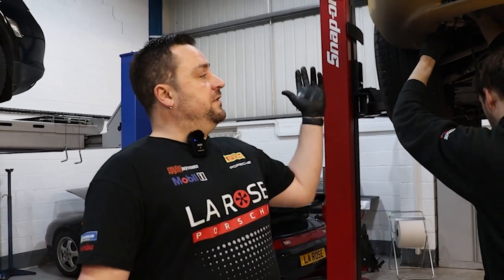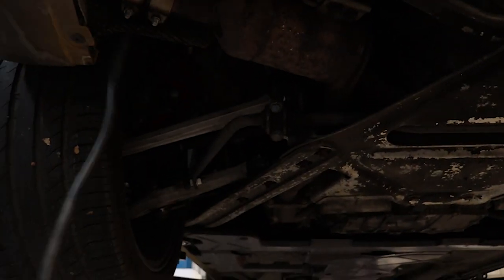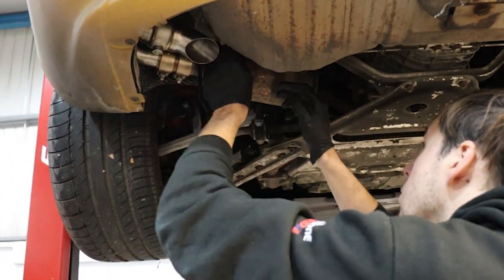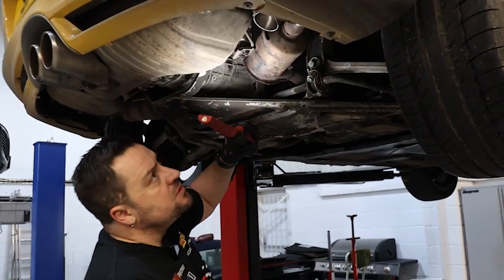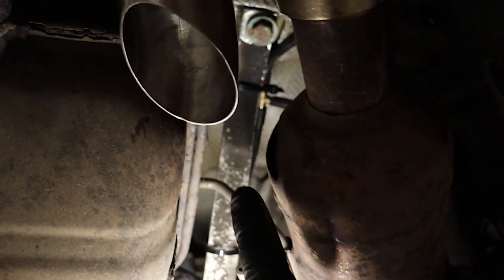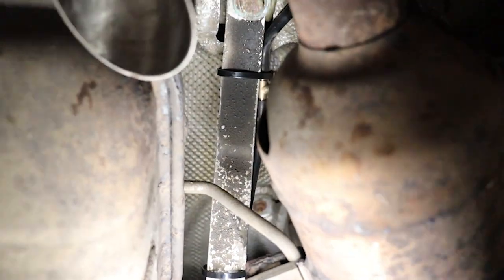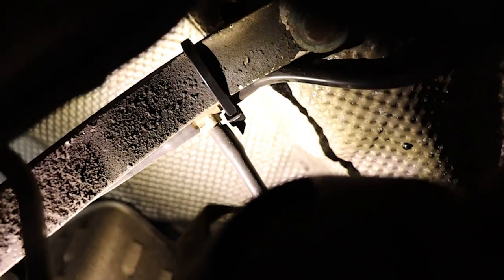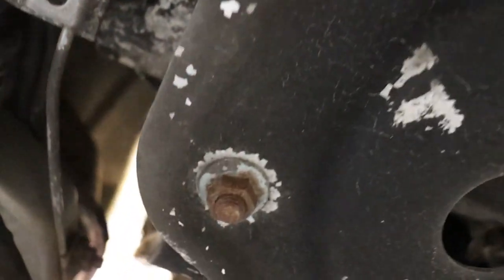What we're going to do now is start prepping the vacuum side. As you can see, Alberta's installing the silicone hose that comes as part of the kit. Once you run that up to the engine bay, we're going to install the electrics. You'll see that we've installed the vacuum lines. These cable ties don't come as part of the kit — we will try and encourage the factory to include them going forward. We've located the T-piece just up over here, and make sure that the hose clears the cat converters, because if it touches them, it will actually melt. Then up here and over to the other valve.